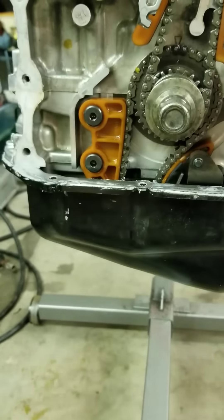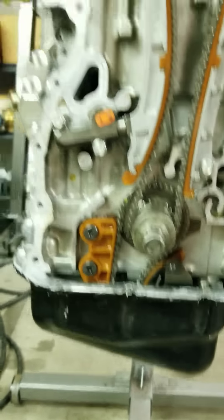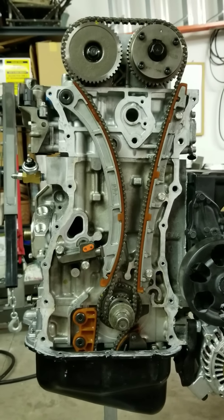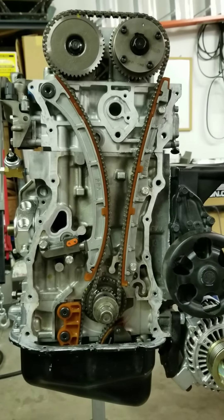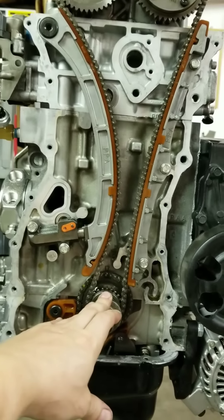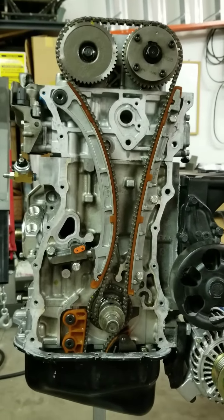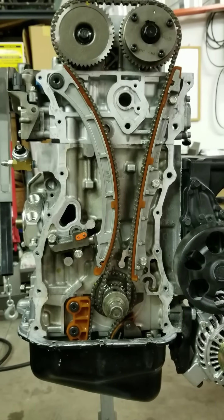So you've got one, two, three, four, five, six — down here in the oil pan there's one — so you've got six or seven different markers you can watch for. In the back where the cams go, you've got the dowel pin alignment. It's really easy to time these engines now that they put those dowel pins in the back. You just need to make sure your crank is at the right position when you put your cams in, so that cylinder one is at top dead center.